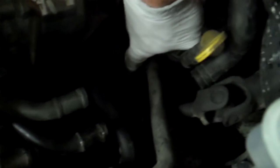The next thing I like to do is the bolts that hold the motor in. There's actually nuts. There's one that's down here. You can see the CV axle barely, but in front of the CV axle there's a little 14 millimeter nut. You want to pull that one out, and then on the other side there's another one, same story. It's a little easier to get to, but there's a nut down here on this side. There's basically 4 points that the motor's held in by. There's another long bolt here. You pull that out, and then your motor's free.